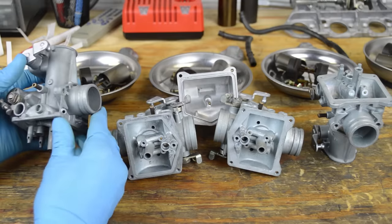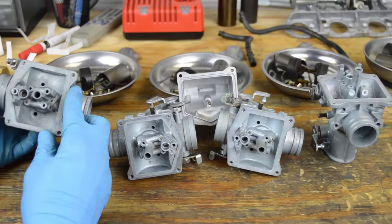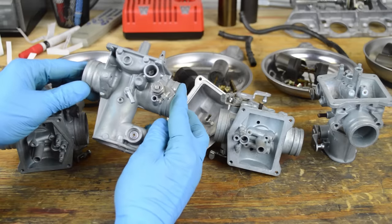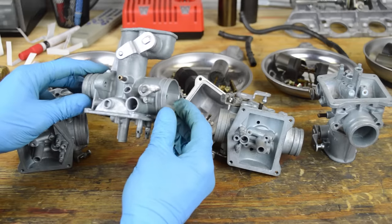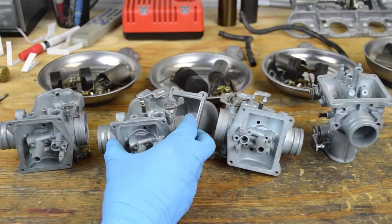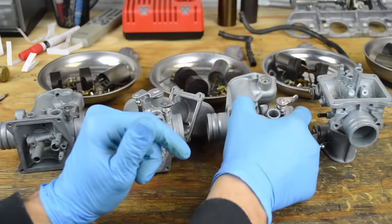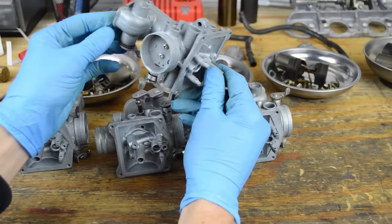I spent, I don't know, an hour or so blasting everything, and my soda is completely spent. So I need to go to Harbor Freight and buy a 40-pound bag of the soda, and then I'll be back in business. Also, the soda gets sucked up by the vacuum, so you're working with less and less soda as time goes on, and the pickup tube starves, so you have to keep smacking it or get in there and move the soda around. But yeah, this is great, man. You rinse it and you're all done. Rinse it in water or the ultrasonic tank, and you are ready to go.